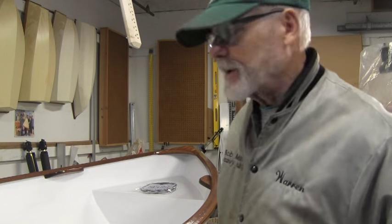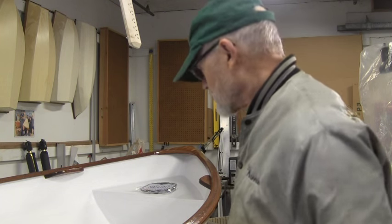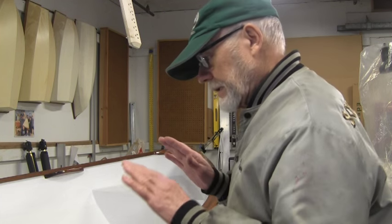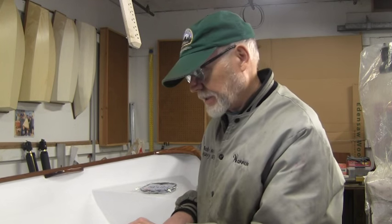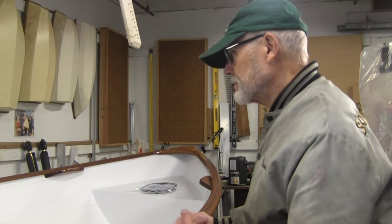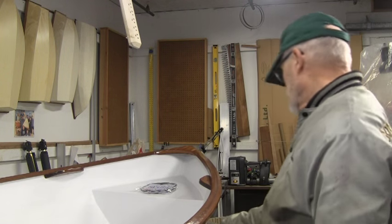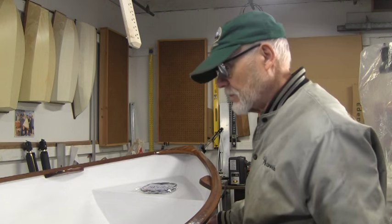Welcome back YouTubers — I steal that from Ally Knight if you watch her trucking series. This is the 15th of March; she's on a cruise so the hull you'll see is back on its bottom again. It's been a full two weeks — about an hour ago the clock would say two hours because we just had daylight saving time last night — but it's been a full two weeks cure on the paint and it seems hard as a rock. I think this stuff is going to be like gel coat, kind of like LPU but the next level up.